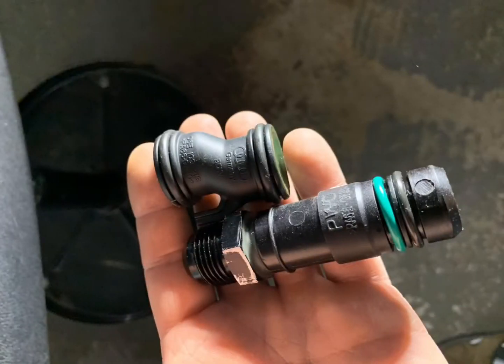As you can see, that's the piece I did with the 10AN. Next to it is your PCV inlet for the supercharger. What I did was fill it with JB Weld and wait one day for it to dry, so that air won't pass through that piece. That way we've pretty much blocked the inlet for the supercharger.